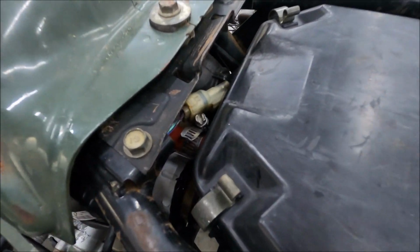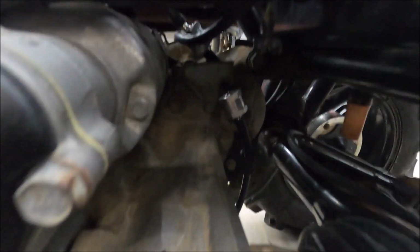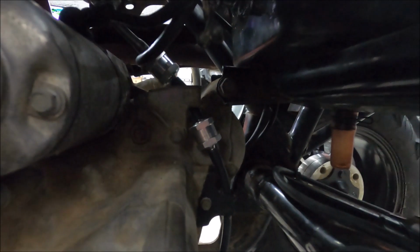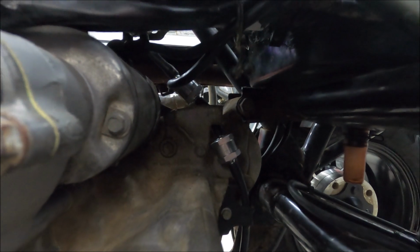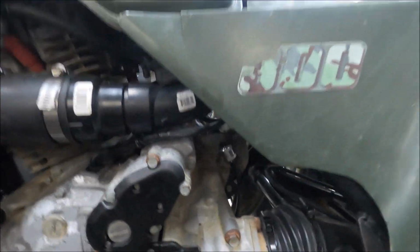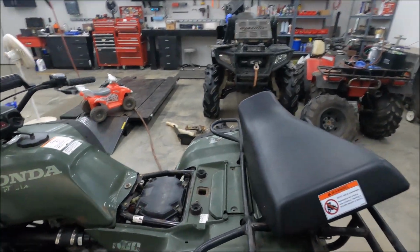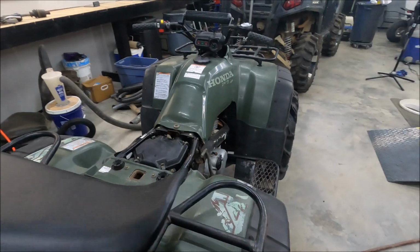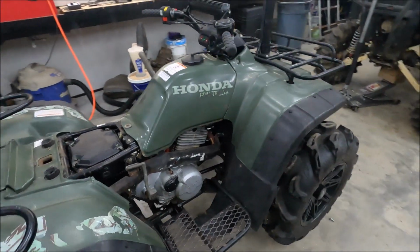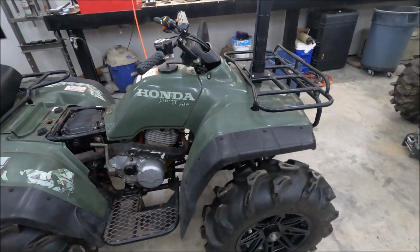Into the airbox there, the crankcase is looped up around there and then back to the top of the airbox. Over here, if you can see back in there, those 2 aluminum fittings, that's actually the aluminum one-way check valves. I didn't think they were going to make that big of a difference, but my gosh, it is instant. It's not a ball check valve like on the OEM setup. That there, I got those doubled up, so the float's going to be very well protected. I do need to add a rear spring spacer. So that's kind of the second phase of this thing.